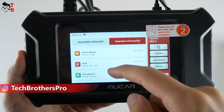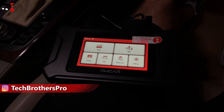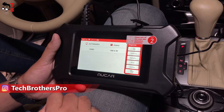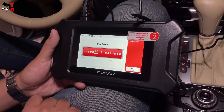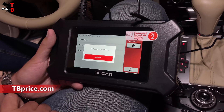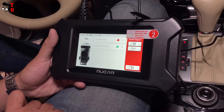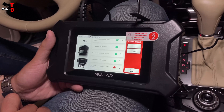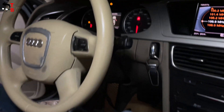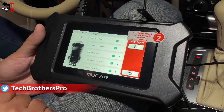Let's see how to clear the error codes on the vehicle. First, you need to connect the scanner to the OBD2 port of your vehicle, which is usually located on the left side of the steering wheel. The scanner doesn't have a built-in battery, so you also need to use a USB Type-C power cable. When the scanner is turned on, go to the Scan menu and start auto-search. The VIN codes were found very quickly. After that, you can select health report, system scan, and system selection. I selected the health report — the device scans all systems of the vehicle and reports all error codes. I have some error codes in engine, electronic central, and comfort system central. You can then press Clear DTC to clear all the system's stored memory.